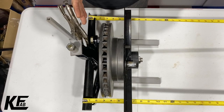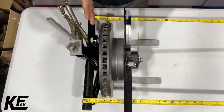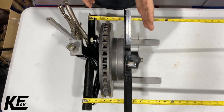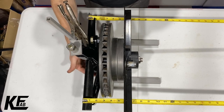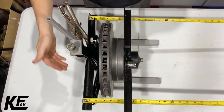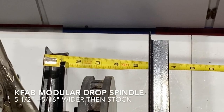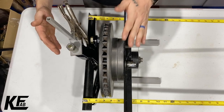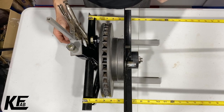This is our modular brake drop spindle at two-and-a-half-inch drop. The drop and the brake caliper mounting bracket has nothing to do with the width of the spindle itself — the limiting factor is the lower ball joint running into the rotor, so this is basically as narrow as you could possibly run it. From the center line of the ball joint to the face of the wheel is five and a half inches — that's only five-sixteenths of an inch wider per side than a stock drum brake spindle.